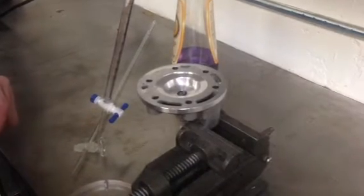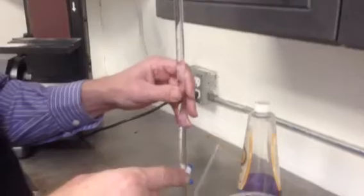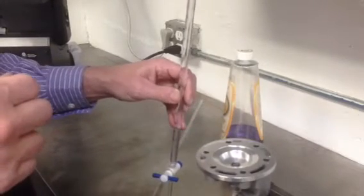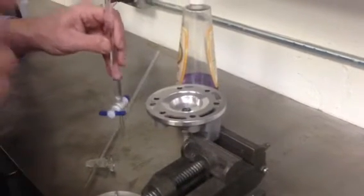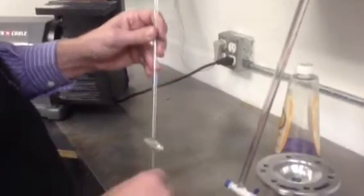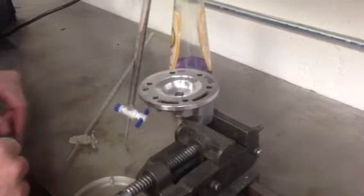The main tool you need is a burette, which is filled with lamp oil and is what I use to measure the volume. You can also use syringes if you can find one calibrated correctly — automotive guys use them, but they have bigger volumes. This is a much smaller volume. These burettes are about $150 a piece, so it's not something everyone would want to buy. This smaller one is for smaller heads, or I can use it for the final filling on this head to get a more accurate reading.